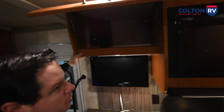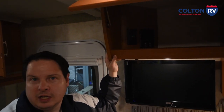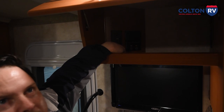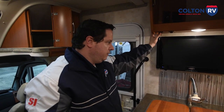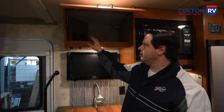Coming to this cabinet here, there's one thing that's hidden inside. When you get to a campsite, you have to go into the TV setup and auto-program it just like you would at your house — scan for channels. One thing I get a lot of calls about is people can't get a channel to program. Nine times out of ten, people forget there's a powered antenna on the roof. Some people will turn this off so it doesn't drain the battery. But this button here — if you're auto-programming and not getting channels — you've got to make sure this button's pushed in; you'll see the light light up.